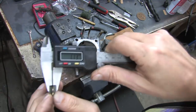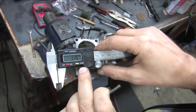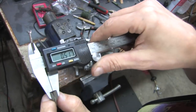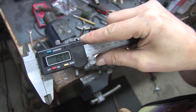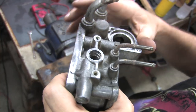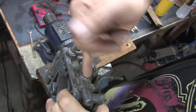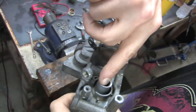The spacer washer used in the assembly is 1.15 millimeters, or 5/100ths of an inch thick. The plastic washer is a half a millimeter, or 2/100ths of an inch thick. The diameters and thicknesses of these parts and their arrangements were all carefully planned by the engineers because the bore they live in is drilled, countersunk, and sleeved. While it's strange compared to their other designs, it's actually really cool, and it gives an inside look at how creative the engineers really were.